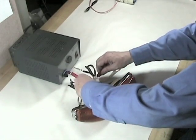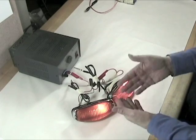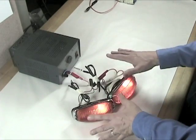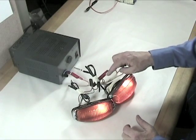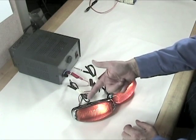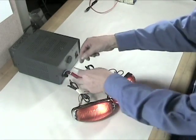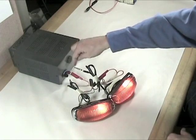So let's go back and reconnect the small lamps. Again, there's no ground on one side. How in the world is this lamp functioning with no ground? Sherlock Holmes once said that when you eliminate the impossible, whatever's left has to be the truth. I have eliminated the ground here — she's not grounding there. So the only way she can ground is through the other lamp, because it's the only other ground connection. If that's true, if I disconnect this ground, I should lose that one. So I disconnect the ground and they both go out — both lamps are grounding through the other side.